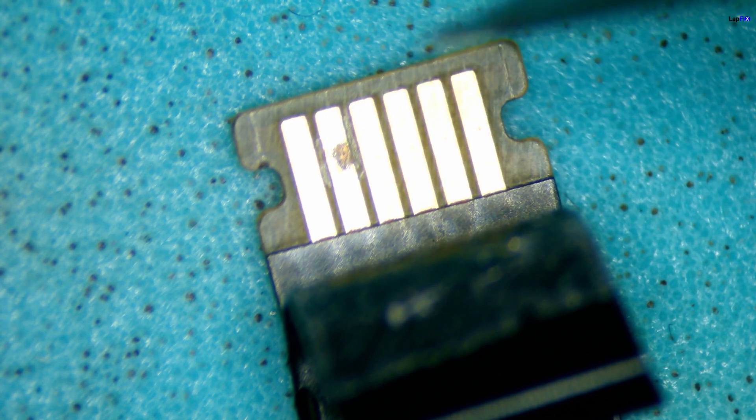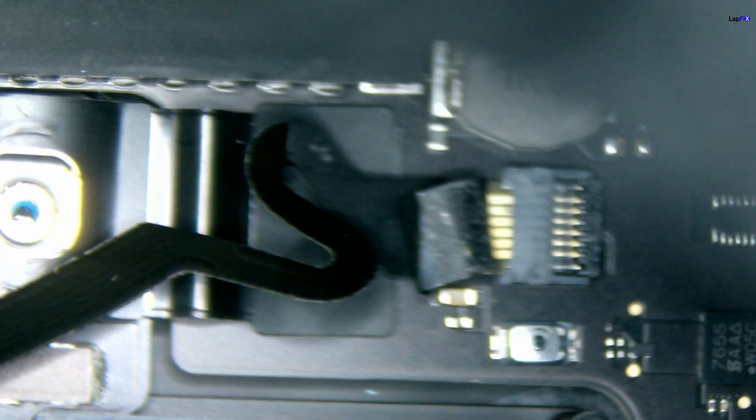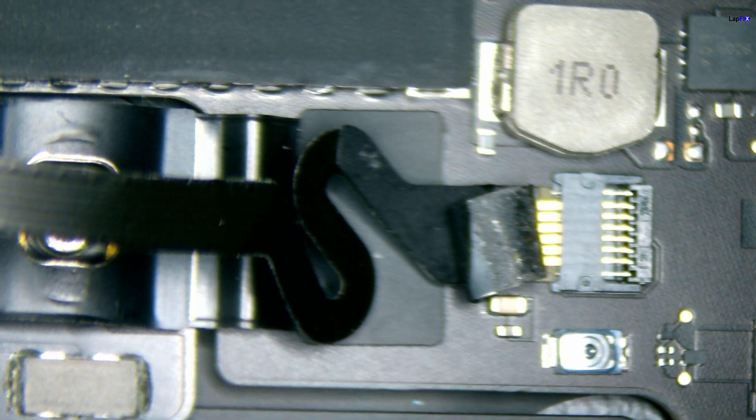We can see there's a speck here — it looks like a cut or a tear. Obviously the battery was replaced, and there was probably a bit of a struggle and this got ripped. This is really easy to damage. Here's why: the cable connects to the plus and minus connector and there's a latch that closes it. If you're trying to unplug it while struggling — wiggling left and right — it's very easy to tear. If you don't know there's a latch that holds it down, you'll have problems.